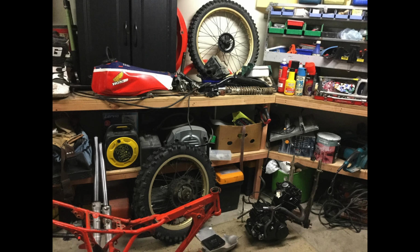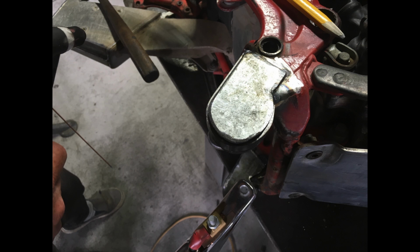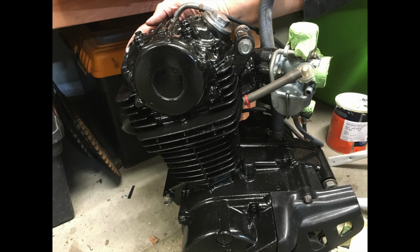One area that we were particularly interested to do was lower the foot pegs. On a TLR, you're standing a bit high, the centre of gravity is all wrong, and it transforms the bike tremendously if you have foot rests that are further back and wider, back and down. So we did that, but first of all we had to make a couple of little cardboard cutouts that we used for both sides. There was a lot of work in grinding out and making the area right to put the brackets to the frame.